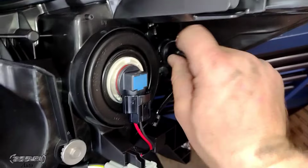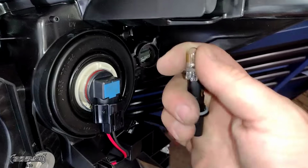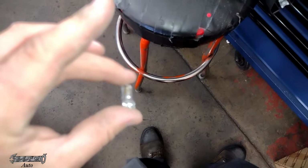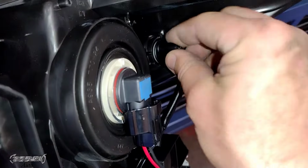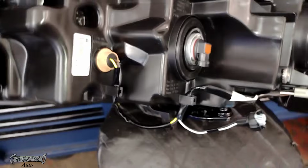This bulb that's over here is your outside bulb. It's like a little tiny bulb. I forget what number it is. I'll put it in the description though. I'll put links to all these bulbs in the description. And then you put your new bulb in, and then you put this in and twist it like that to lock it in.